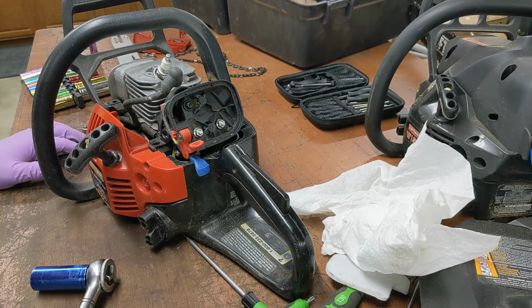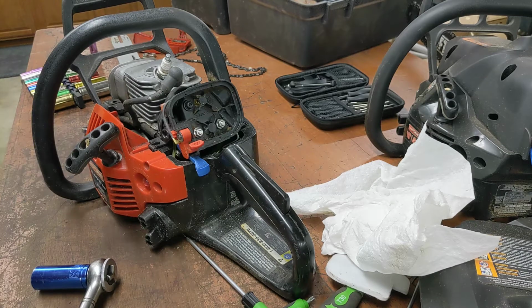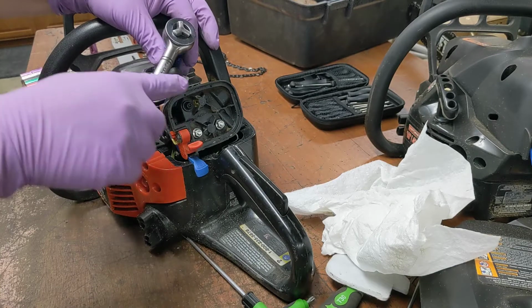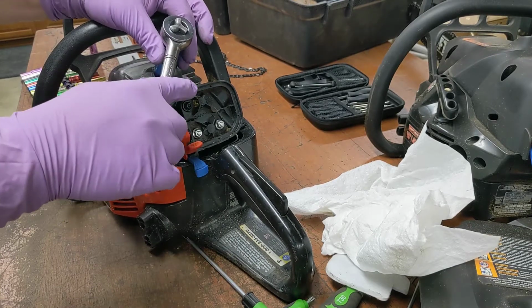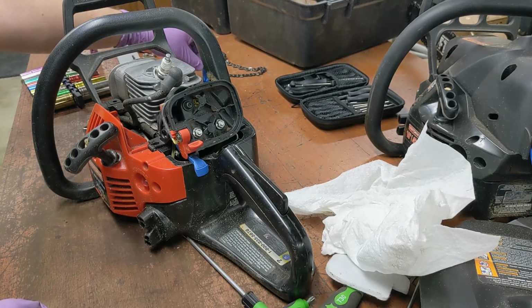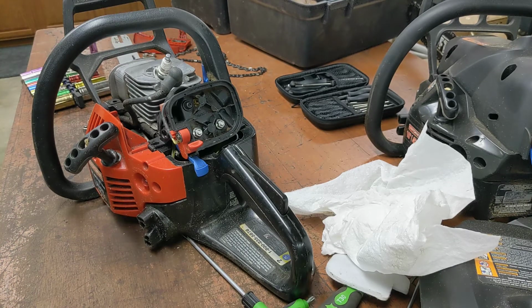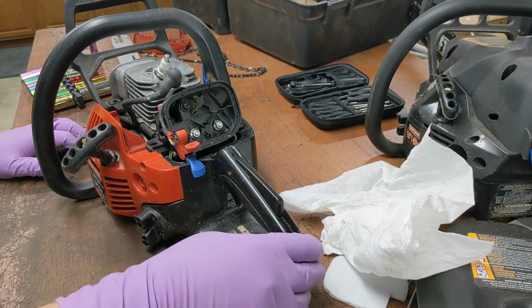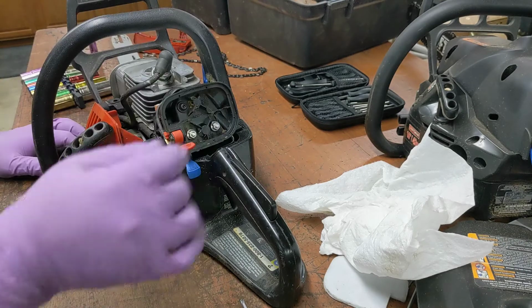Hook your air hose to it. They have abrasive that's in there. You just poke the spark plug in the top and swirl it around and it cleans it up. And then that tester you saw makes it real easy. It's a combination of all these things. We know the coil's good. It generates a spark. You know the plug's good because it sparks on a known source. Everything's kosher for spark on this machine.